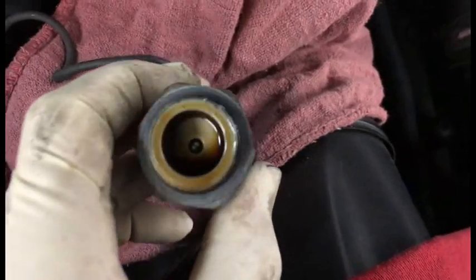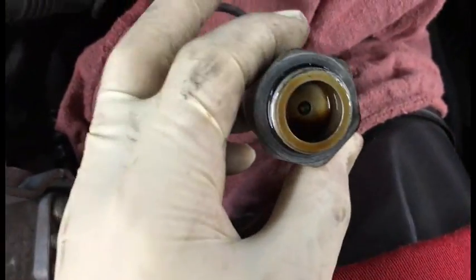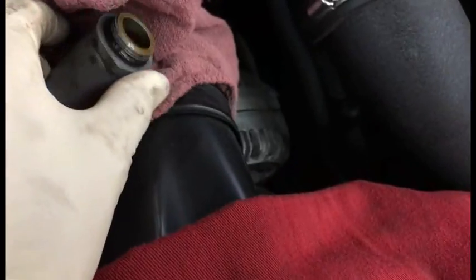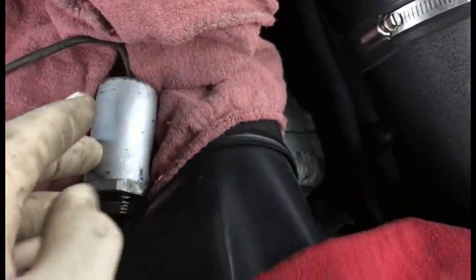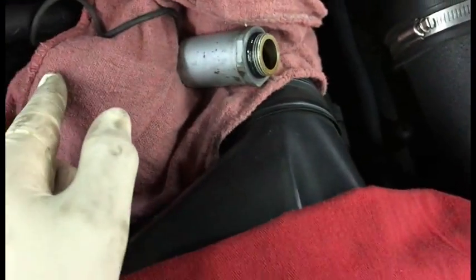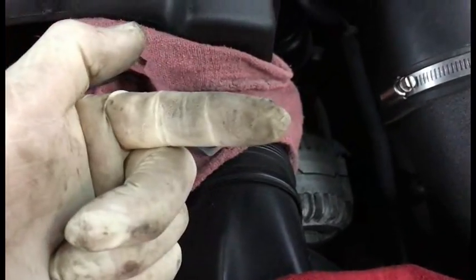Anyway, when the Vanos solenoid activates, it sends an electronic signal, and that pin will fire out, and then it will retract. It should happen pretty quick. My old Vanos solenoid was kind of going bad, so the firing pin was really slow, so I bought a different one, and you can test it if you just put 12 volts of power to the connector, and it should just go click and then retract, and that's it. So anyway, here's the sensor right in here.